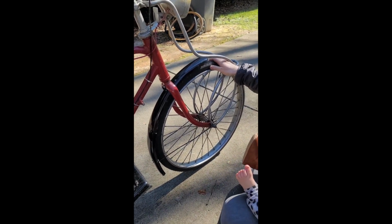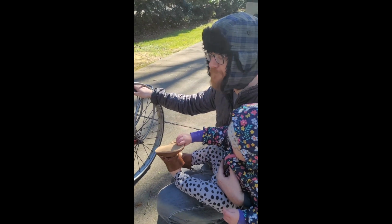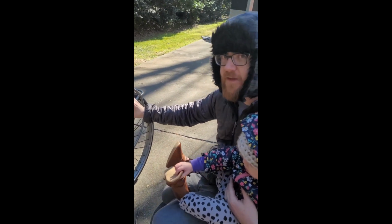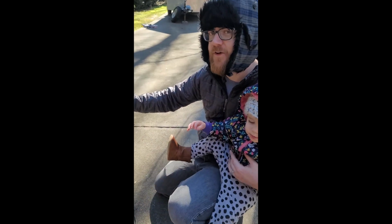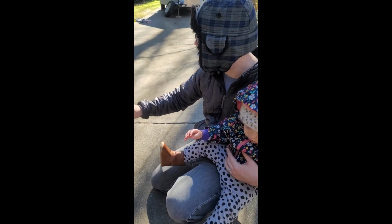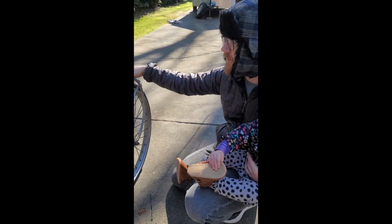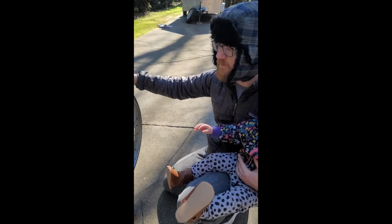If you go to Walmart and just buy a 26-inch mountain bike tire, I don't think it would work, because we had a tire that we think came from Walmart, and it didn't fit over the rim. So in case you're looking at that, just look for the marking that says 40 584, 50 584, 52 584, and if you find one with the same ISO code, it'll work.